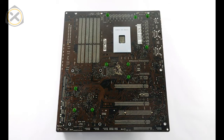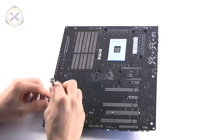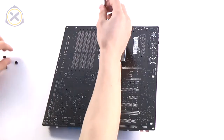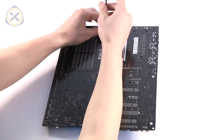Now we can begin with removing the original heatsink. On the back of the mainboard you will find 10 screws that need to be removed. The heatsinks will not come off just from removing these screws, since they are attached to some components with pretty strongly adhesive thermal grease.